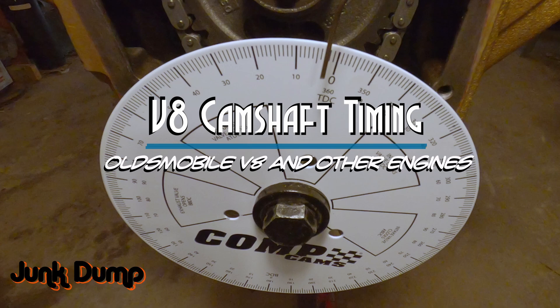Firstly, you want to check these specifications to find out if your cam was ground in properly or even if you have the correct camshaft. Measuring cylinder 1 and then cylinder 8 will tell you if there's any twist or deviation between the whole camshaft. Also, these cam timing specifications are important for us to decide which kind of camshaft we want in our engines, depending on how you use it.